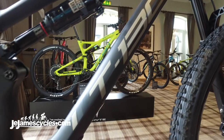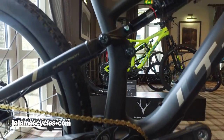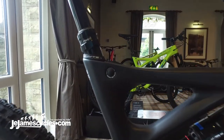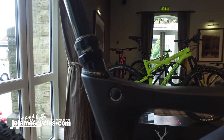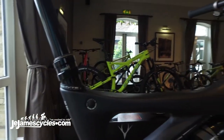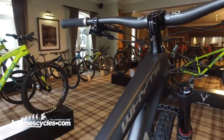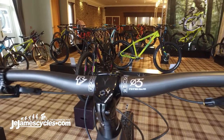The carbon front triangle is full SCR design, so there's no provision for a front derailleur. The rear suspension is all designed around 1x drivetrains, which makes a much more symmetrical system. The chainstays are much more symmetrical, and the rear torsional stiffness of the frame is 25% increased over the 2x frame that has provision for a front derailleur.